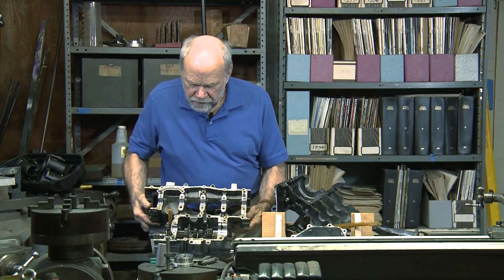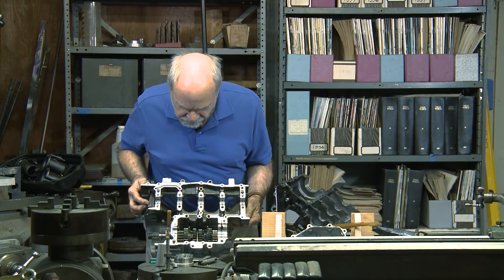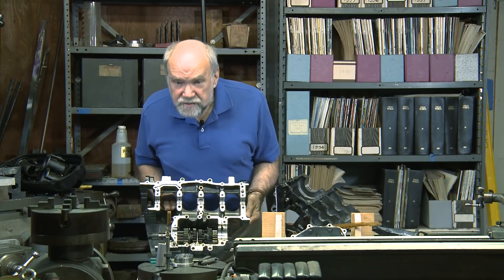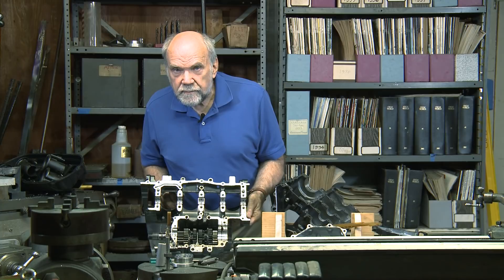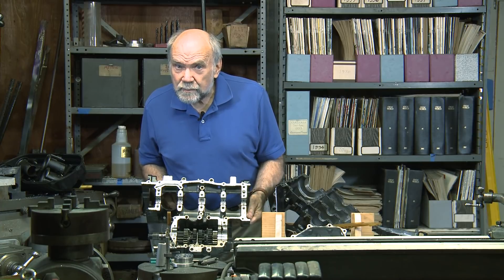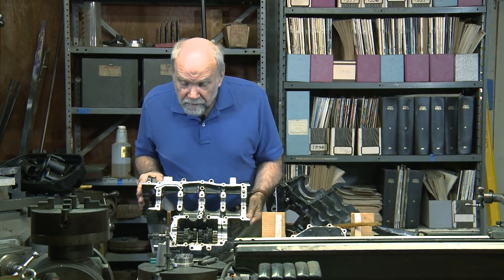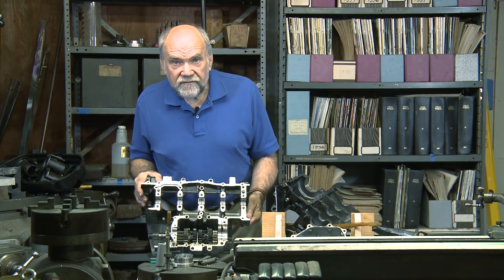This is the upper crankcase, with the matching upper halves of the crankshaft bearings and the four cylinders. Each cylinder's bore is hard plating directly on aluminum — this is done because it eliminates the insulating effect of the iron liners that used to be used. Old-timers liked those iron liners because they can be rebored, but this engine can't be rebored. On the other hand, this engine takes care of itself so well that in 25,000 miles it hasn't needed any help.